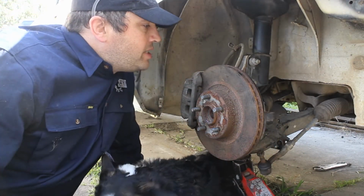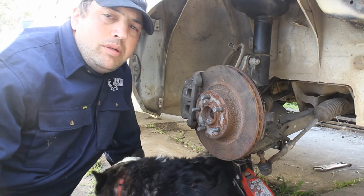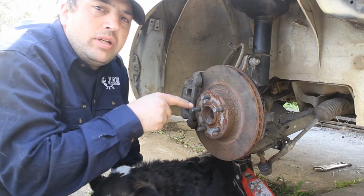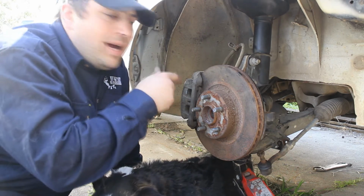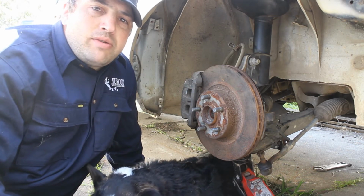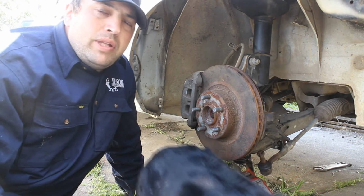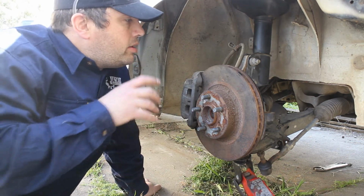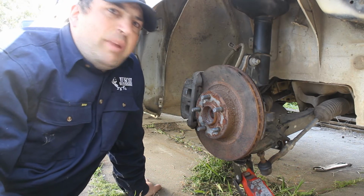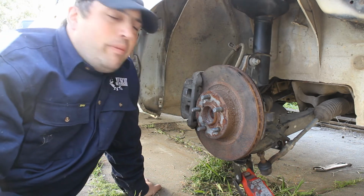So what I'm going to do next is get the original Liberty shaft, which is way too long, chop it in half, install both halves, and then mark the shaft so that I can cut out the extra that I don't need, tack weld it together, and then once that's all done, I can take the centre shaft off to an engineer that has a big fancy machine and get him to print out a couple of new ones, probably out of chromoly.